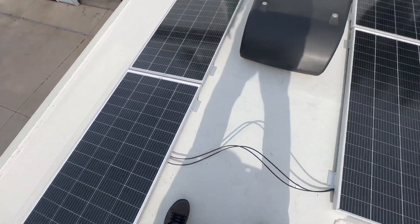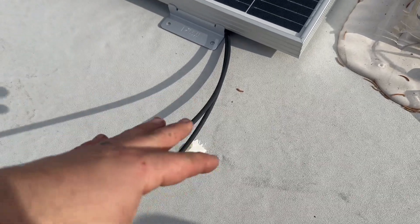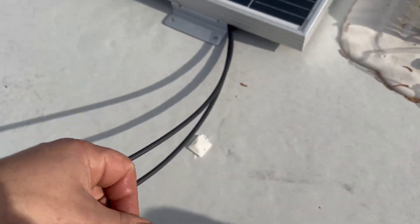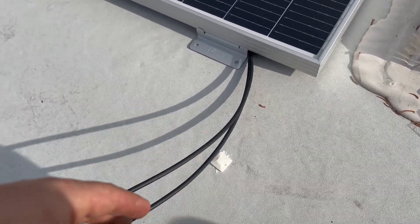The other thing — I know you guys like when we share little tidbits. I've started putting a thin coat of Dicor underneath these 3M tabs and I let it sit there for a good half hour to an hour. Just a light coating of Dicor, and what that does is it gives it enough time to skin over so it'll actually adhere to the 3M mounting tab for the zip ties. Then we'll put some Dicor over top of it, and over time the Dicor is actually what's holding that down — not the 3M adhesive, because that just doesn't last on these roofs. You see solar installs all the time where these are pulled up and not holding anymore. So that's what we do.